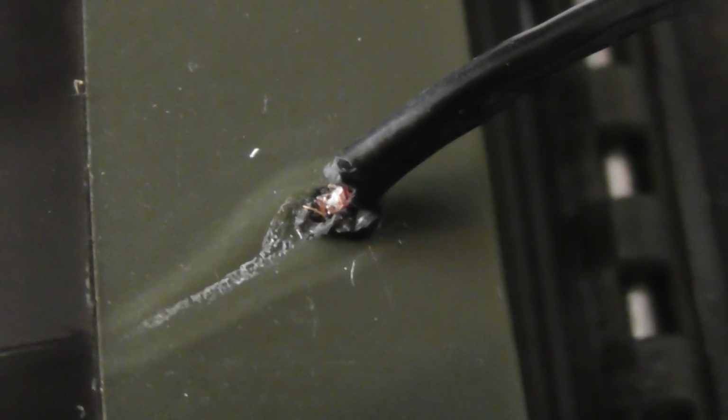See, that's what I'm just going to show you. That's what the cable should look like. The cable goes through into the green plastic like that. No sign of that one rubbing or failing yet. And again, at the other end, that's what it should look like. And just so that you can see the difference, there you go. I've got that black trail of melted wire on the green plastic there, stuck on the surface, and the cable has worn out, failed at that end, just from opening and shutting this, like I say, maybe twice a day. Once to put an SD card in at night, and once to take it out in the morning.